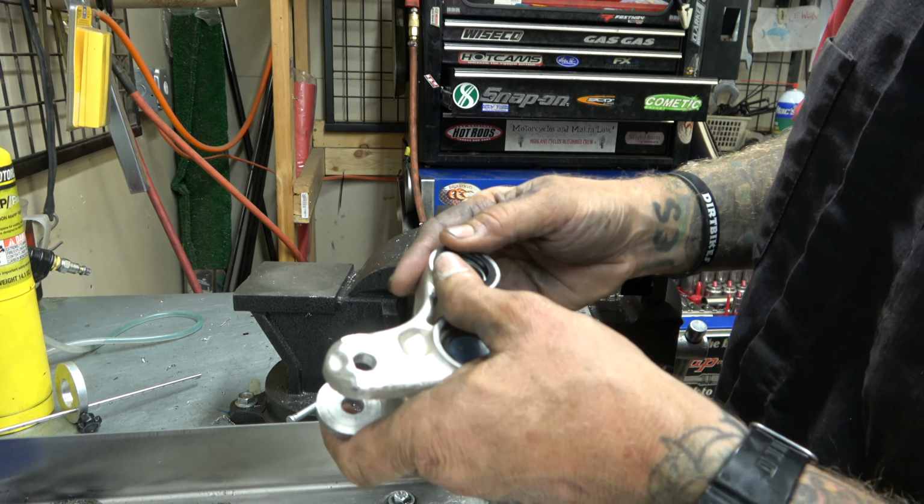They go in really easy, so you just push them in. Other side. There we go. Got a brand new race. Take a little bit of grease, put it on there. And these bearings already have grease on them from the factory, but you want to put a little bit of extra there, and you can start to push the plastic out, but you can do it with this race so that you don't lose any pins. It just goes in like that.